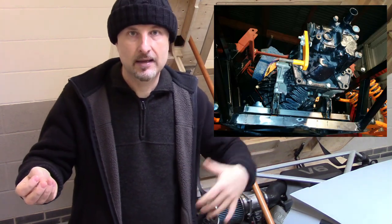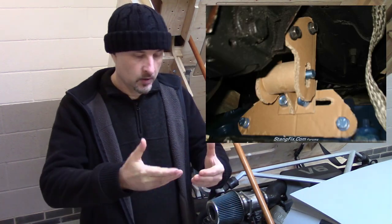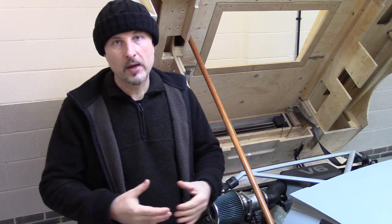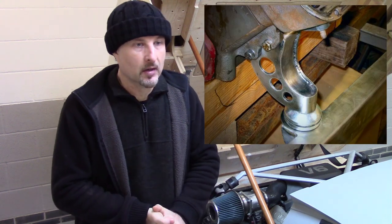A little bit like the Countach chassis I did — there's a playlist on my channel if you're interested. When designing your own engine mounts, cardboard is a really useful tool. You can make the plates out of cardboard, see if they line up and work, before you cut them out of steel. This is really common when people build their own hot rods. Here are a few pictures of some interesting engine mounts — I particularly like the one with the spanners.